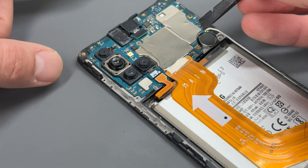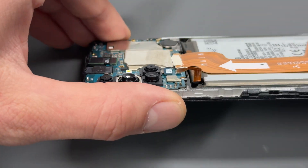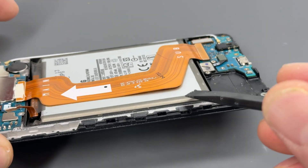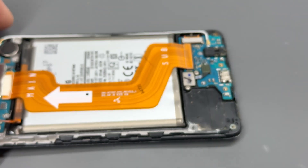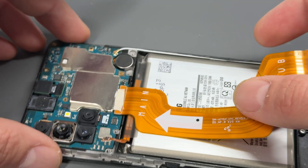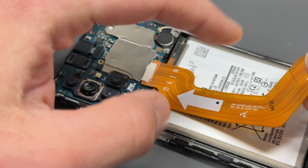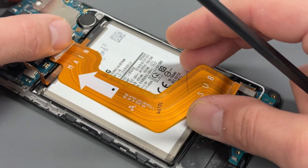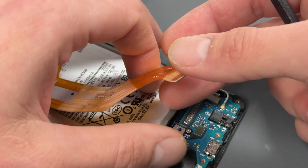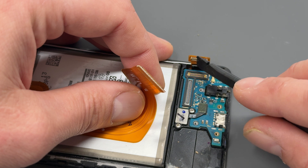Next I'm going to ignore this bit of tape — I'm not sure what's going on with this phone, obviously some kind of repair has happened before. First of all I'm going to disconnect the battery. One thing I am going to look out for is a notorious fault with these where a cable runs from the top to the bottom and stops charging, but I don't think that's happened to this one. So instead I'm just going to move down to the bottom and disconnect the cable there. If your phone isn't charging, there is a chance that repair may be required. This one has got a chewed up charging port. Because we're replacing the charging port, we've disconnected this flex cable and now we need to disconnect the display cable.